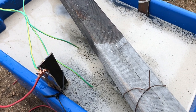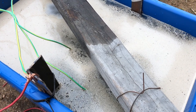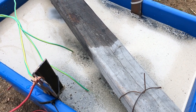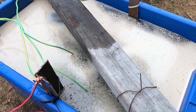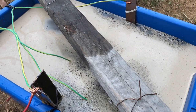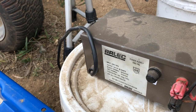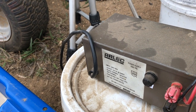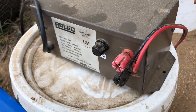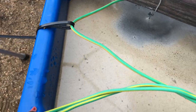So this is sodium hydroxide, it's about a four or five percent solution. That's going to only evolve oxygen and hydrogen as the water molecule breaks down. Hydrogen's not great, so we do it outside, but it's better than some of the alternates. Like if you use stainless steel, you get some nasty stuff coming off it from your anodes — so avoid using stainless steel anodes. We're just using this transformer — it goes 240 to 12 volt and that comes out at about eight amps. That's a fairly hefty current, it'll push it along quite well. A couple of amps is all you need, as long as you can work out which is positive and which is negative, and make sure your positive goes to the anode and negative to the object.